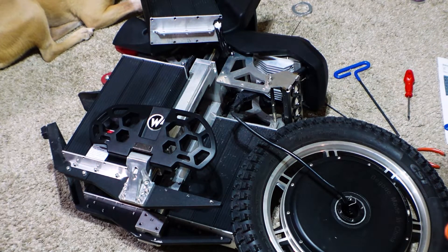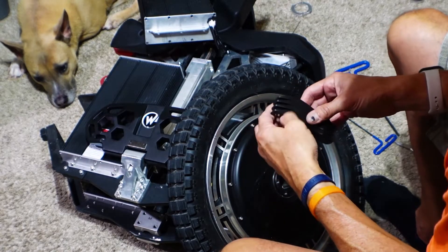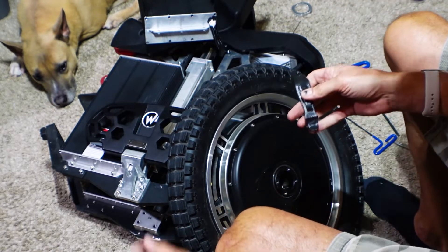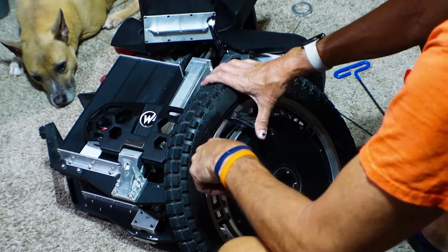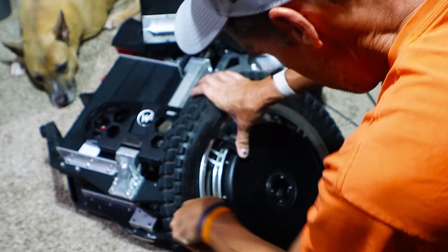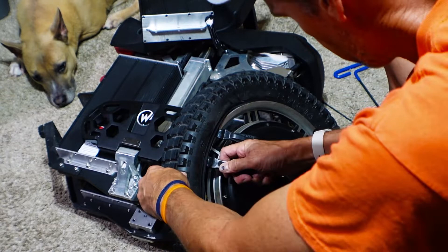So I'm going to work on getting this tire off - I'll let you know if there are any gotchas on it. I've done a decent amount of tire changes so I just expect it to sort of suck. You need to work the tire off the side without the cable. I know when George did his he used metal tire irons. I prefer to use plastic where I can, because metal tools will have more of a tendency to damage the tube, which I like to avoid.